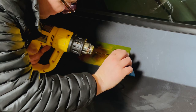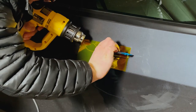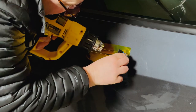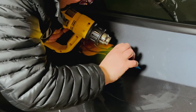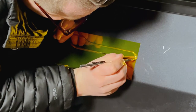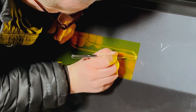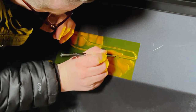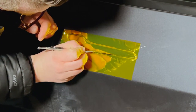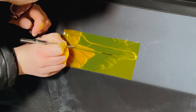Before I started this project I actually almost wanted to wrap the entire door handle, but that really doesn't make sense at the end of the day. There are some you can buy off the internet that'll wrap the door handle completely, but it ended up working out really well just putting it around here. I had the heat gun set to about 250 degrees. A lot of people use it on really high heat — like 400 to 600 — but they'll only hit it for a couple seconds and then work with it really quick. As it starts to cool off it'll form more and more to the object.